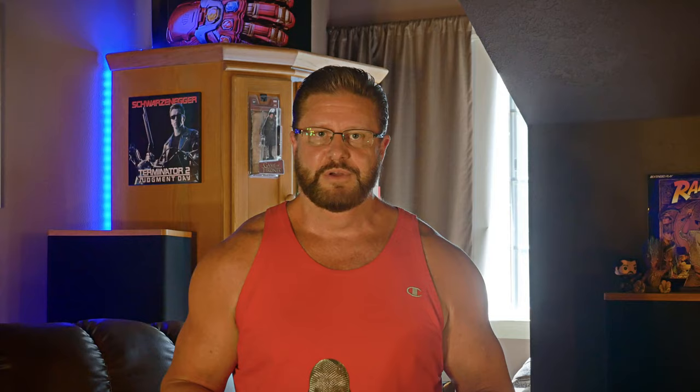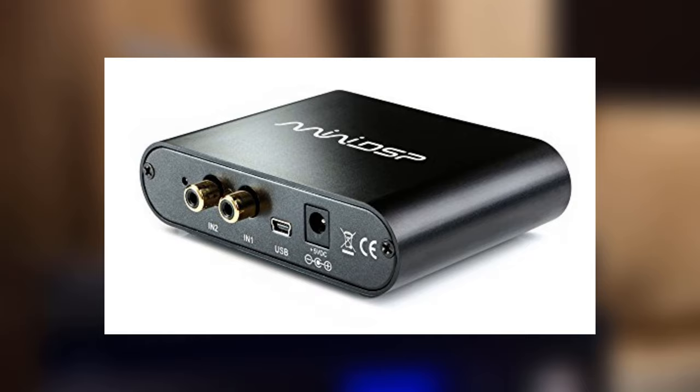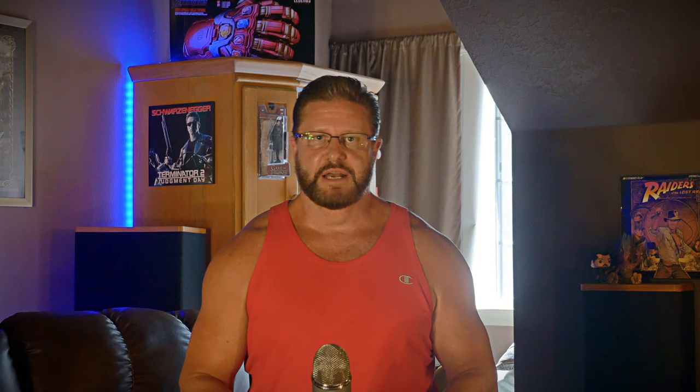Now you've got all your main speakers set up for your room — what about your subs? Subwoofers are really hard to get just right, especially without an EQ. If you have two subs and you're not careful you could actually be canceling out one of them. Sub EQ is pretty cheap and relatively easy. I have my subs running through a Velodyne SMS-1 for room correction and I could hear a massive difference once I calibrated them. The mini DSP is also a great choice for people on a budget — I'll leave a link in the description.